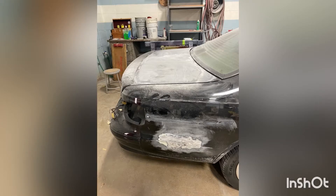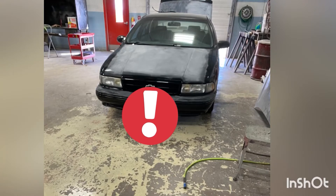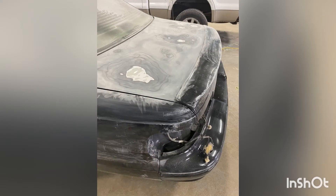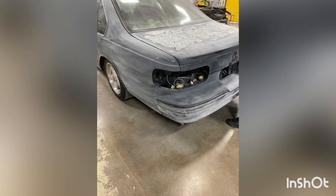There's another picture — we got that deck lid sanded out towards the beginning, just smoothing everything out with a light pass. Right there we got the bondo, working with the body line. Coming up here, we just sanded the hood, still kind of the beginning, and the bumper we were starting on. Next we had to feather out all those cracks, and then we scuffed those sides and took off the Impala SS emblems, getting it nice and smooth.